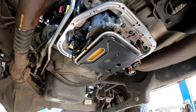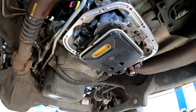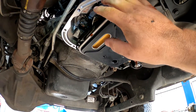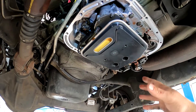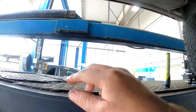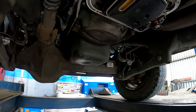It does not need any additional help. If it needs additional help, that's because of some issues with the case itself, and that might mean looking at possibly replacing the case. If silicone was previously used, get all of it cleaned off and make sure you have a nice even pan flange. This being aluminum, make sure you are not using any metal razor blades — use a plastic razor blade and plastic brushes, and make sure it's nice and dry. We'll have to torque the pan up evenly so it smashes the new gasket without collapsing it. The new gasket has raised edges that need to be collapsed down evenly.